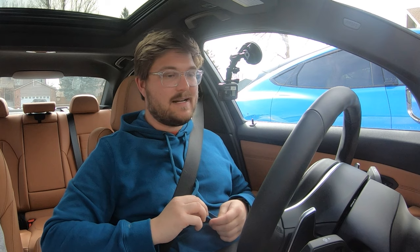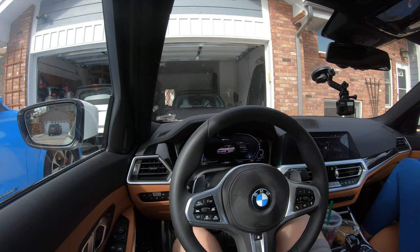One downside with this electric system — just like with most BMW PHEVs — is that the electric motor is ahead of the transmission, which means it actually shifts gears. If you're cruising normally and put your foot down to the kickdown switch in electric mode, it stays electric. But if you depress the switch at the bottom of the pedal, it kicks on the combustion engine — a stone cold engine at full boost. You can feel it shift gears; there's a pause, the transmission kicks down a couple of cogs, and then it goes.